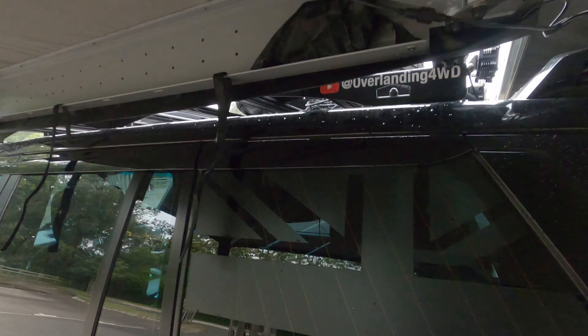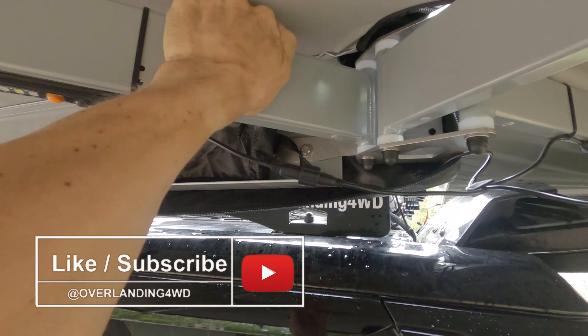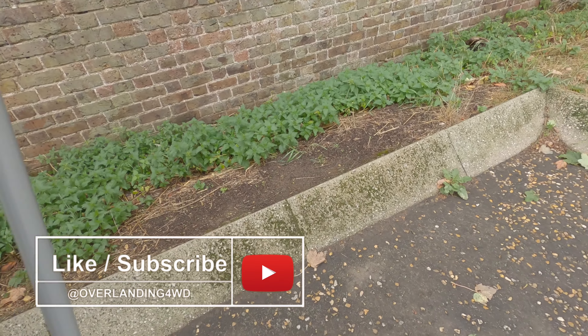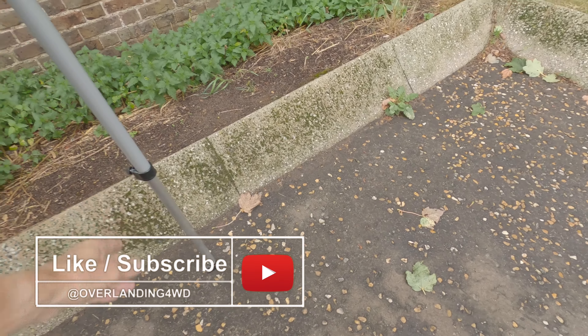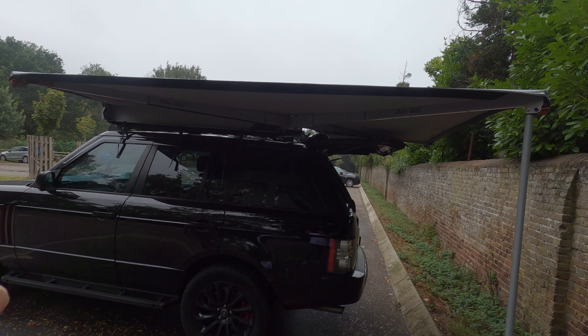The way this awning works is it's freestanding, and it really is rock solid. I can pull on this and the only thing that's moving is the car. One leg, and under inclement weather you can push this in and drop the leg down. The bottom of every arm has some tie-downs, some guy ropes on each of them. Like a lot of things with these awnings, if it's windy, take them down. These are really meant for shade — get out of the rain, get out of the sun. You're asking for trouble with any awning unless you've got it bolted down really well in wind or thunderstorms — none of them will withstand it.